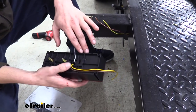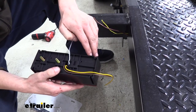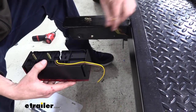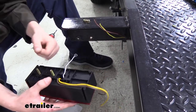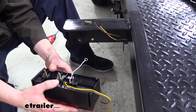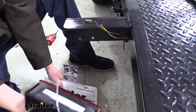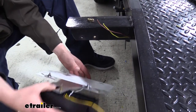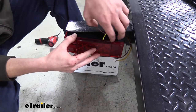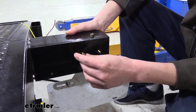Now that we've got our mounting location chosen, make sure you take your wiring and run it through the channels on the back so you don't pinch your wiring. We're putting our stop and tail wires off to the side so they'll meet our wires coming off our trailer, and our ground wire we're going to run out the bottom to connect to the stud on the back side. Since this is the driver's side, we've got our license plate light on the bottom, so we want to make sure we put our license plate on, then slide it through the mounting holes on our trailer.